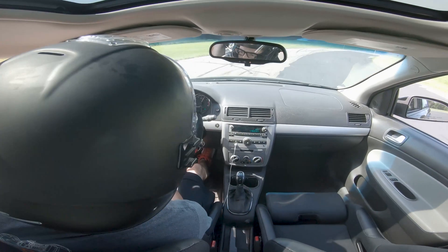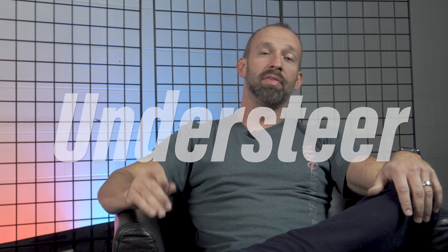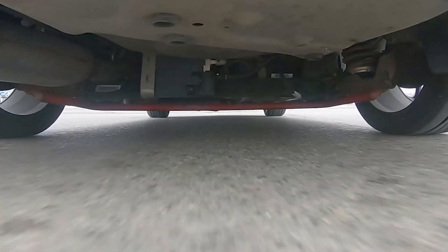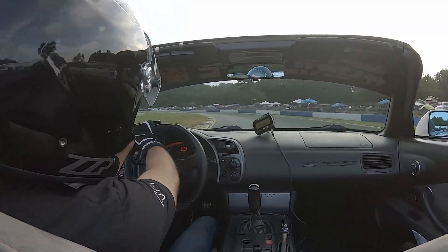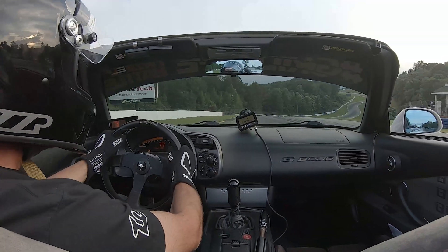Let's say you're coming into a corner, barreling in fast, you slam on the brakes, let off the brakes, turn the corner, and the car just goes straight — wheels turned straight. That's what we call understeer. This is a prime example of a time that you would add a rear sway bar. That rear sway bar will stiffen up the rear suspension, kind of unsettle it a little bit, and it will promote a little bit of oversteer, which can either balance the car or make the car oversteer. Generally, when people are racing cars, they like a little bit of oversteer. I've never met a racer that has ever wanted understeer.